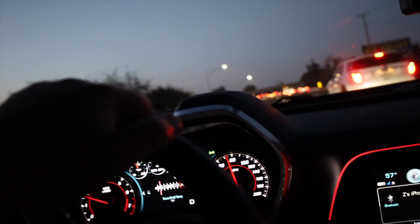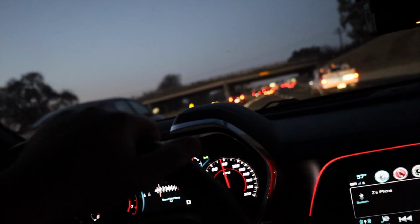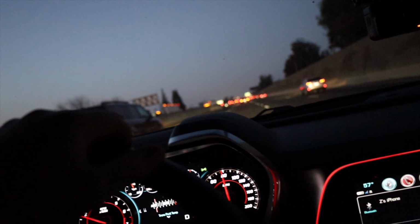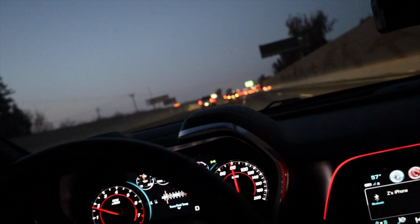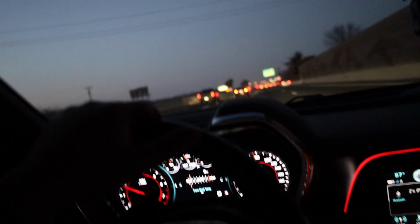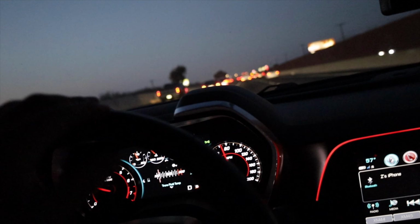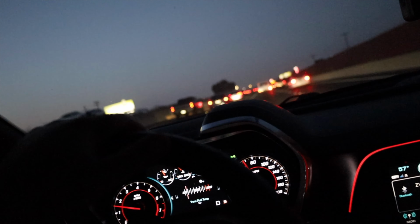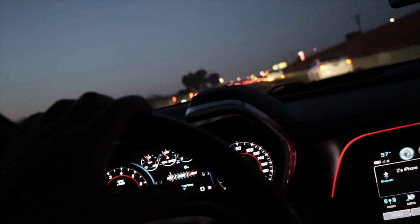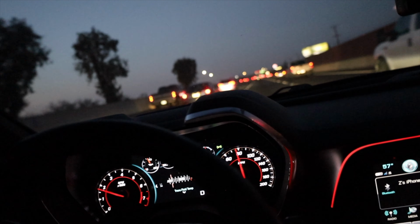But nah, one of the main reasons I wanted that upgraded MAP sensor, you guys, is just because I want to know how much boost I'm pushing. Now, it's not totally necessary for getting the tuning done. As you guys saw, I was able to tune without it, but it's still just really, really nice to know. Now, I do know the MAP sensor is not the most accurate way to read boost. You should have a vacuum boost line hooked up somewhere, but it works. And most of the time when people compare the numbers, they read pretty damn close. It's not that significant of a difference.